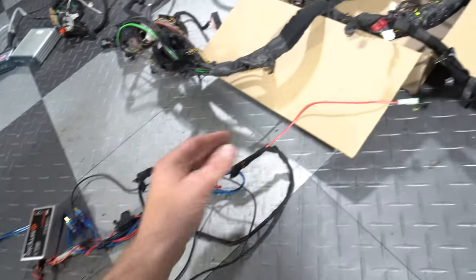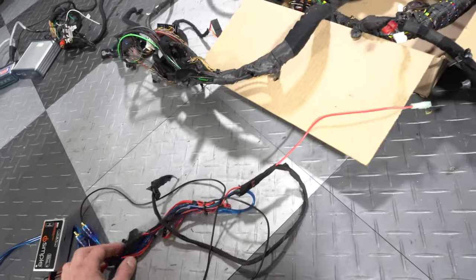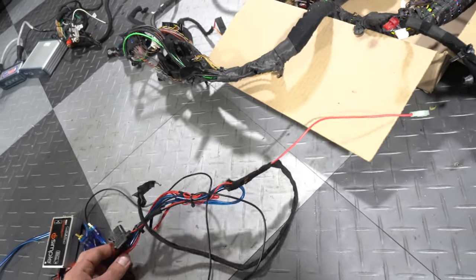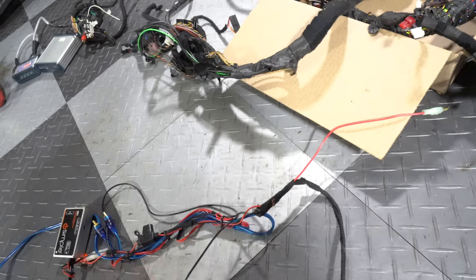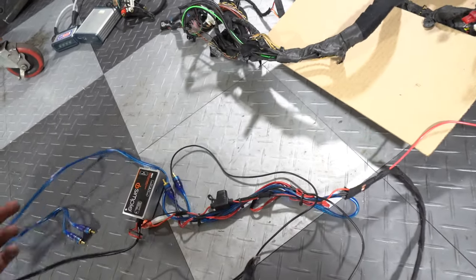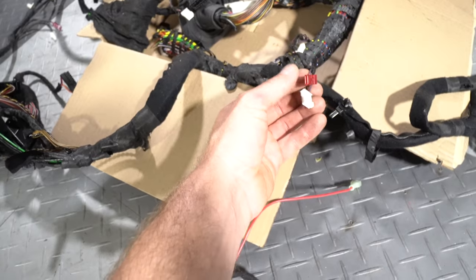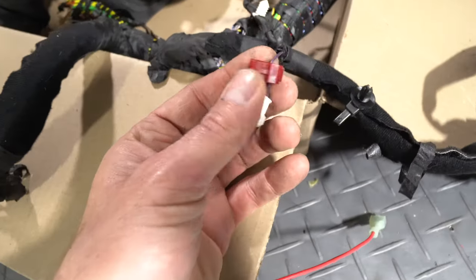Now I'll install the CarPlay unit by removing the head unit and display in the car to integrate the CarPlay's wiring harness into the original BMW harness behind the dash. Then I'll need to hook up power and ground to the CarPlay's module, power from a hot wire at the brake pedal and ground from a bolt under the dash.